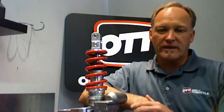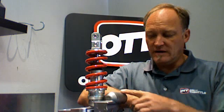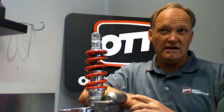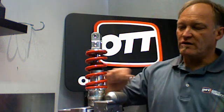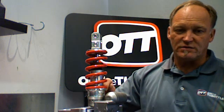If you have a traditional shock with two rings — an upper lock ring and a lower collar, like a Penske or Elka — you can get up to 15 millimeters of adjustment and very fine increments of change. Here we have 8 positions and only get 7 millimeters. If the ramp adjuster is machined correctly you'd expect 1 millimeter per ramp, and with 8 ramps giving us 7mm, it's just under that. So we're very limited in adjustability, which makes it critical to get the perfect spring for the track, the racer's pace, and the rider's weight.